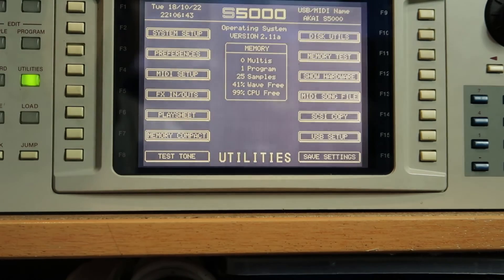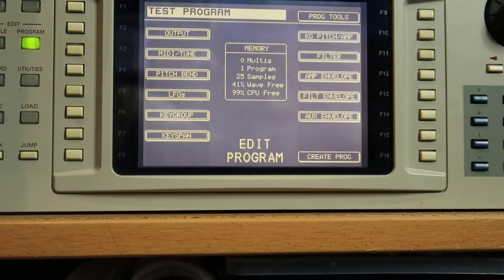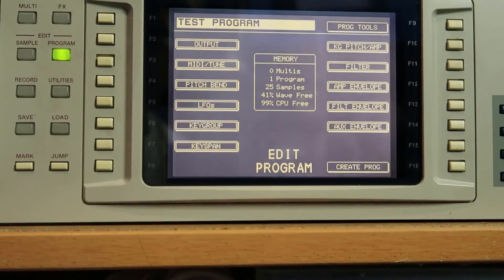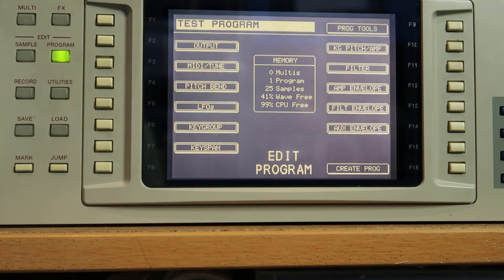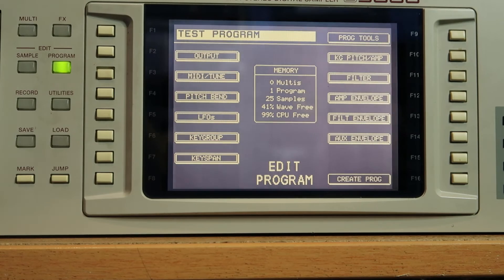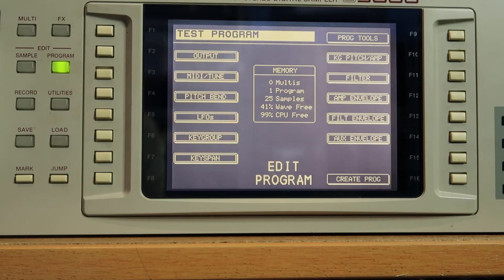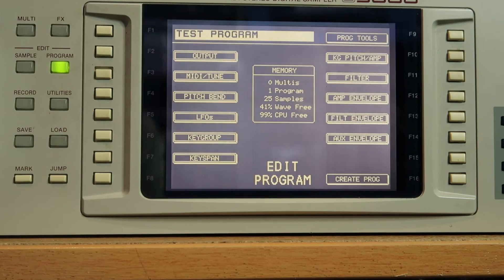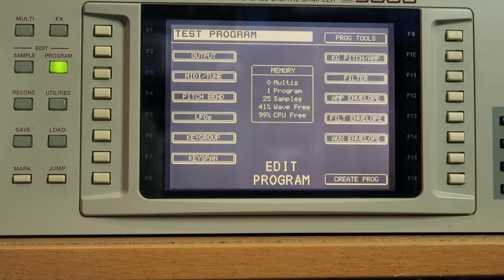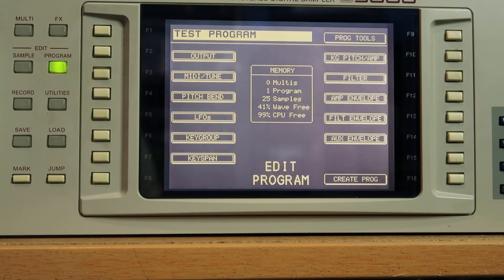Just make sure your samples are 16-bit and you're good to go. You'll want to experiment with the terminator — I believe the terminator on mine is set to on on the RaSCSI. That's it — plain and simple. I find this is a little bit more reliable than the SCSI-to-SD adapter; the SCSI-to-SD tends to be a bit delicate to configure. But once the RaSCSI is configured it works lovely. Check out my other S5000 videos for a full demonstration. Up next we're going to have the Zulu SCSI — I want to compare that, it's looking quite interesting. Guys, that's it for today — hope you enjoyed it, please like, share, subscribe. Take care, God bless, peace.